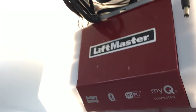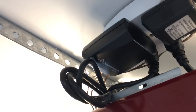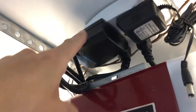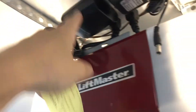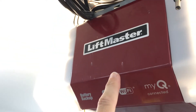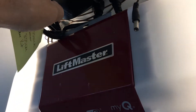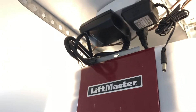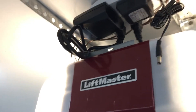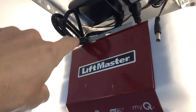Fortunately, there's a solution for that, and that is this HomeLink repeater. This is the 855LM repeater kit. It essentially comes with its own remote paired to it, and you program the repeater kit remote to the opener, then use it to teach your HomeLink buttons in your car how to open it. This basically receives — it talks through this to the opener. It's a more compatible code, frequency, or algorithm — whatever the difference is. So that fixed our car issue.